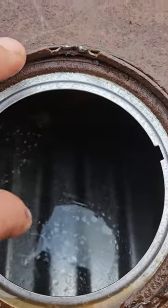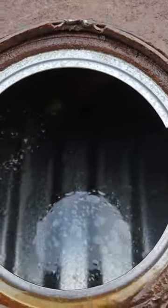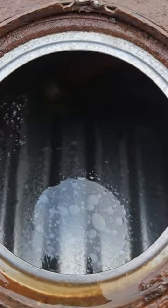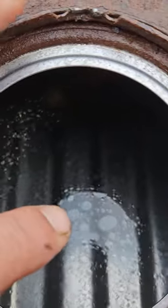You see it's released a new bit of residue. It helps release that film, slime, and gaseous stuff — because Spray Nine has grease-cutting abilities. If you see foamy bubbles, go past that with more Spray Nine. If you see this stuff, that's still fuel — so keep going until you don't see that anymore.